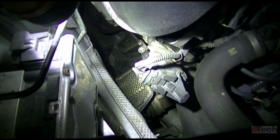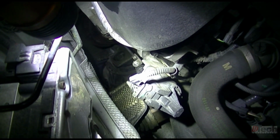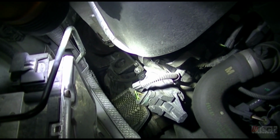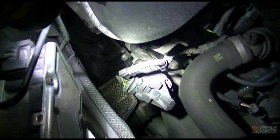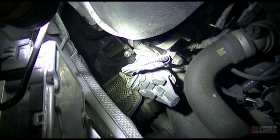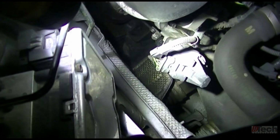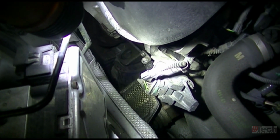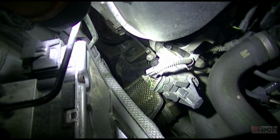The one that I'm particularly concerned with, wanting to take a reading on, is the signal line. There is basically a position sensor, similar to, I would say, probably like an EGR position, like a lift position sensor. I'm assuming something to that extent. It's a 3-wire: a 5-volt sensor, ground, and the signal line back to the DME. Particularly curious on that signal, seeing what is on that in whatever position, and compare that with a new one if we do go ahead and do a new one, assuming that everything else is good on this.